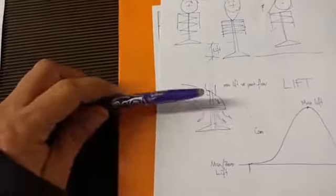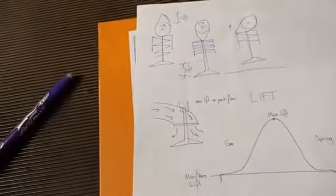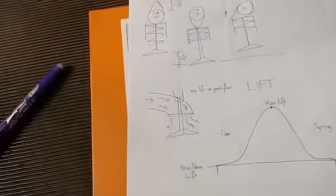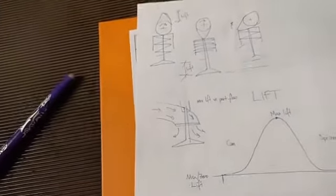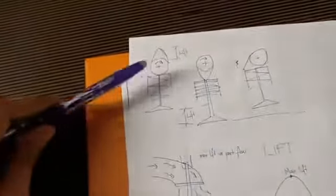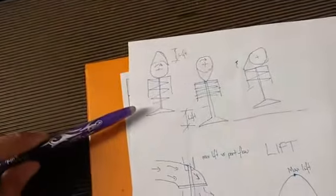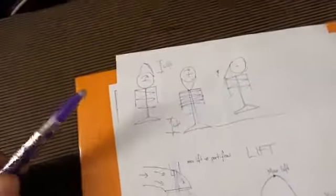What's the downside to lift? Well, to open the valve and push it open in this time, it places more stress and strain on the camshaft to get it that far apart in a given time during the inlet valve event. So normally the less the lift, the less the wear and tear, the less stress and strain on all your working components. With less lift, you generally need a softer spring. Again, we look here at how the system works. We're working against this spring. If this spring has to be really firm to follow an aggressive cam profile, we are working against much greater forces of this spring. So it's going to wear much faster than working against a softer spring.